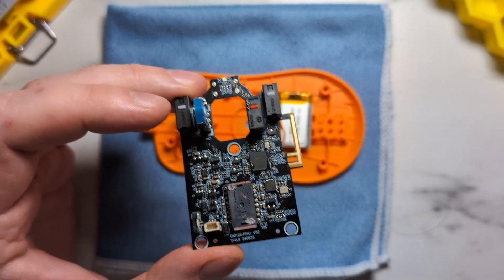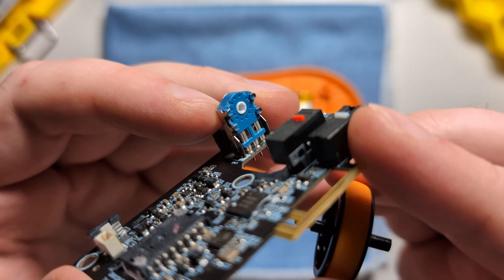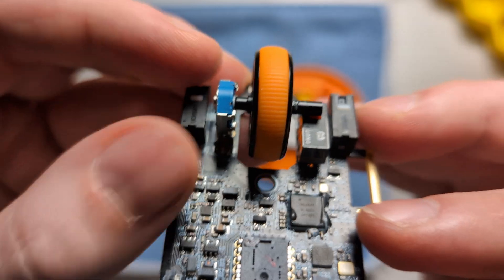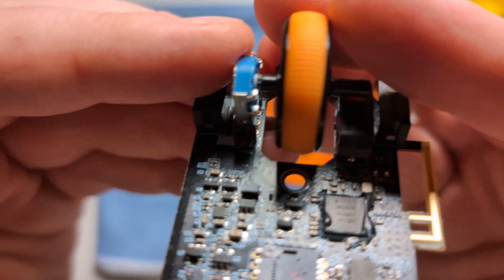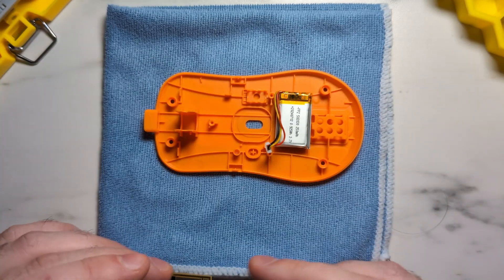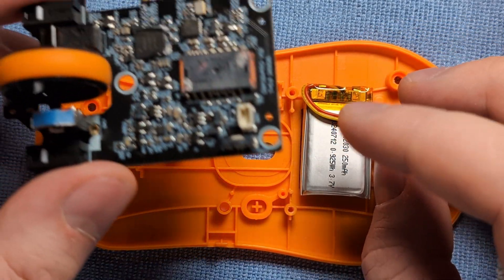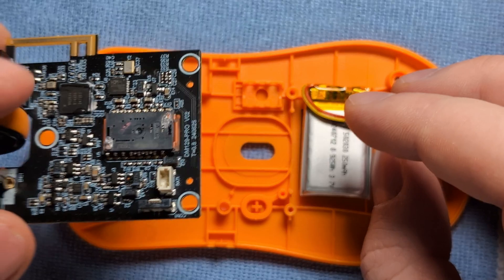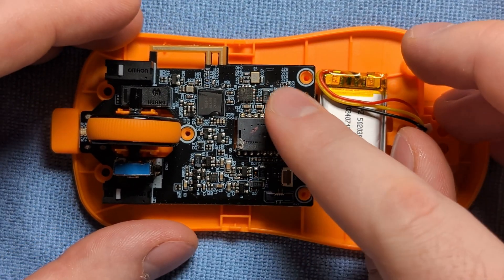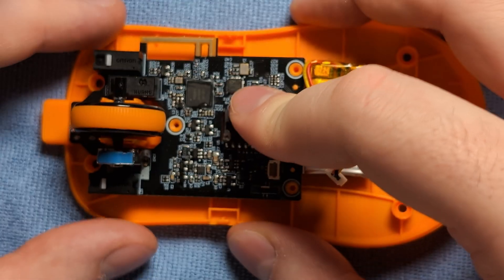Now in terms of the board itself, we can reinstall the scroll wheel. Take the thinner end of the scroll wheel and put it into the little white hole in the encoder, gently line it up and push it in — don't push too hard. I'd recommend leaving a little bit of space on the side since there are standoffs for the scroll wheel. Once the scroll wheel is back in, put the main board back into the base — make sure the switch is in the off position first so you don't break the bottom switch. Tilt it into the front gently and lay it down. Press down until you feel a little click where the bottom switch fits into the slider button.